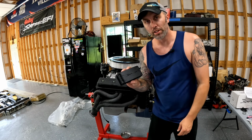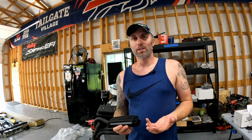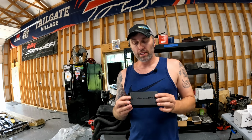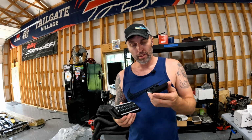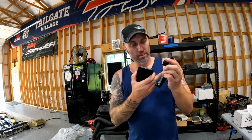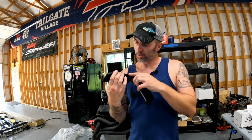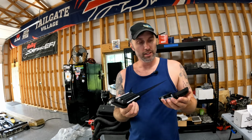And if you're not somebody that's strong on wiring, I love wiring. I love and hate wiring. One of my biggest pet peeves in automotive is electrical wiring. But if you're someone that's not super strong with wiring, these little Holley Sniper PDMs, they tell you the wire: Sniper SW 12 volt pink 20 gauge pin 4. It's got numbers right on the side of it. You go to number 4, you put the wire right there. I mean, it's Jimmy proof.